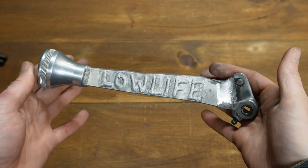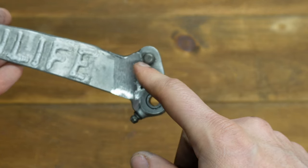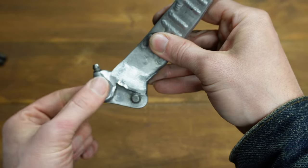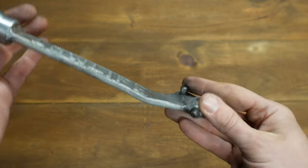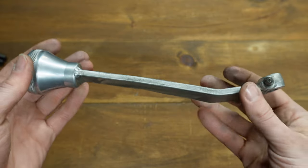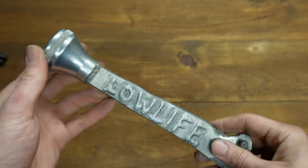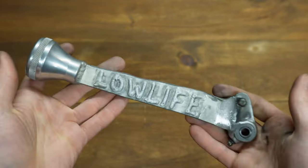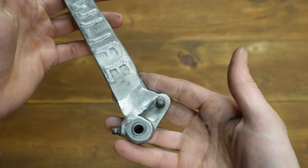Here is a close-up look at the shifter off of the bike. This right here is the stock shift linkage piece from the cowpie transmission. It has a little hump right here with a hole through it, and that's what bolts to your shift shaft. So basically I took this little piece off of the bike, I cut that little hump off, and I welded this jockey shifter arm right to the piece. You actually retain this little zerk fitting so you can continue to grease the bushing, and the entire shifter is extremely light. This is probably quarter-inch aluminum bar stock that I just ground down to a slight taper so that it matched with this aluminum shifter knob that I found on eBay for about $15. I dug this out of the scrap bin, so this is a very low-budget build. But because you're retaining this stock piece, it shifts just as smoothly as it does from the factory.